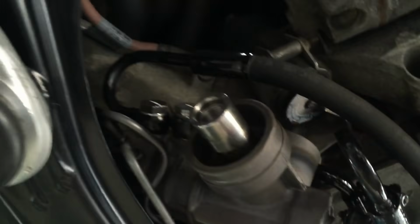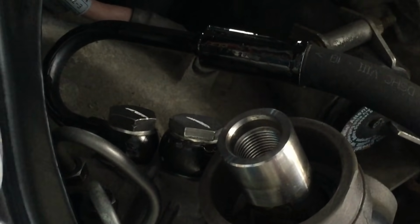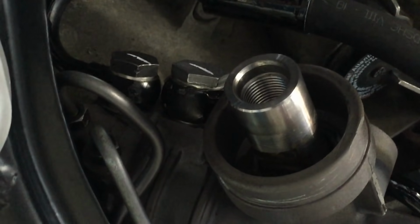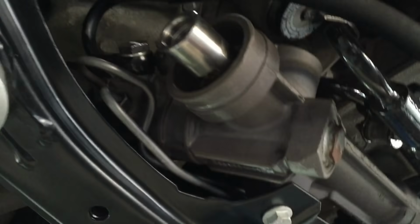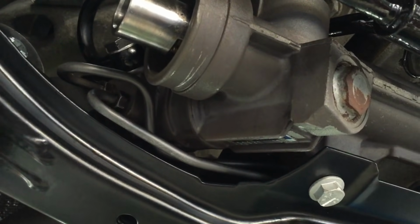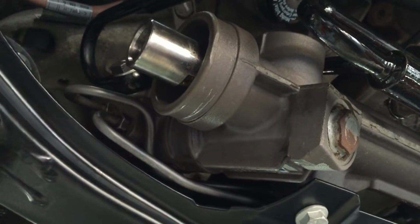And the other thing I've got is the power steering banjo bolts and the new seal washers there on the painted pipes where they connect to the steering rack. One's got a pressure valve in it, so we replaced that as well, and also painted these pipes, the double pipe set, which connects the top of the rack to the side of the rack.